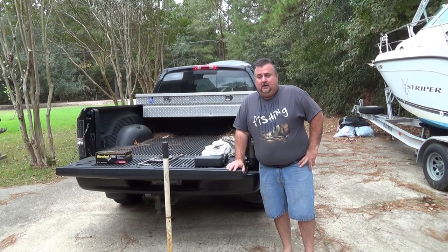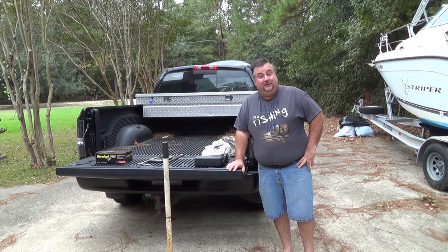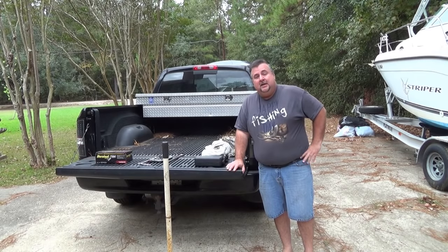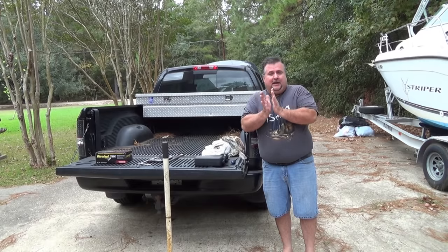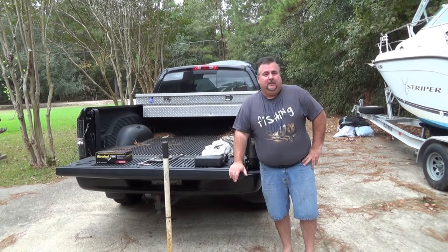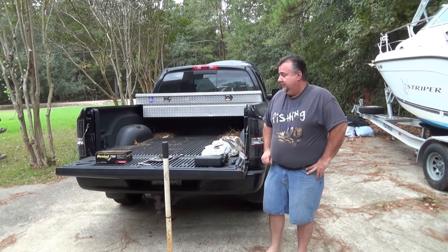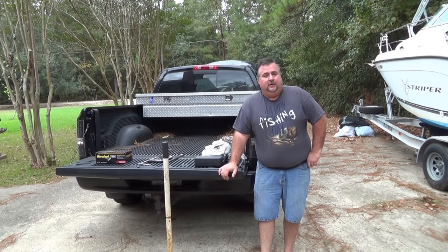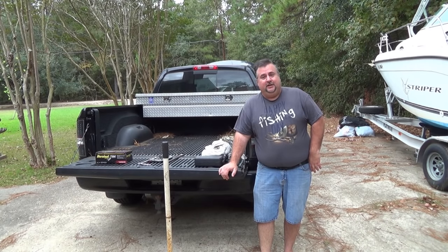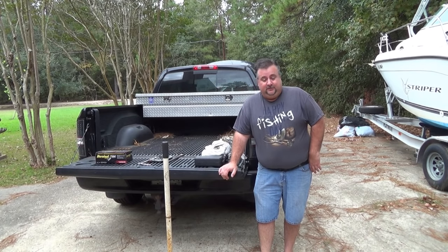So I found some brake pad material in the driveway at one point, so I have a feeling these brakes didn't actually wear out, but that the lining might have come away from the steel backing and that one of the pads is critically damaged. So we're going to go ahead and swap them out. I got some of the high quality ones from a local auto parts store, and hopefully we won't have to change this again in a long time, if ever. So first thing we're going to do is jack up the car and get the wheel off.